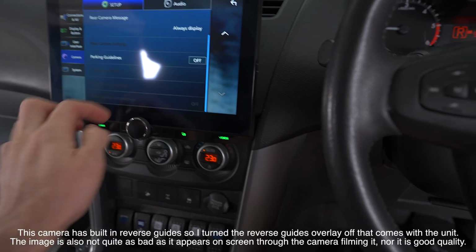So I was curious. I did test both for voltage before I put the RCA cable on to the Kenwood unit, and both represented 0.7 to 0.8 volts DC. So I wasn't worried about reversing those feeds and somehow blowing something by shorting out a 12 volt feed down to earth. Okay, so you see everything's working there.